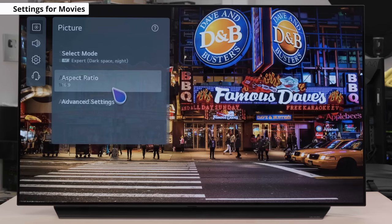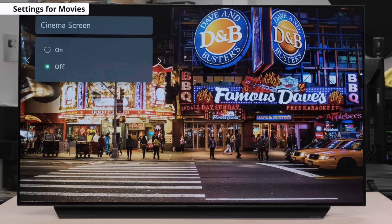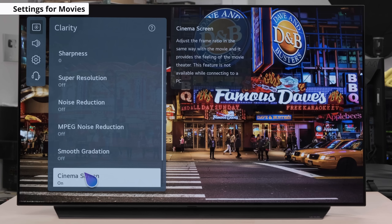Speaking about judder, there is an option on the C1's clarity tab within the advanced picture settings menu called Cinema Screen. This will help mitigate any kind of judder you may encounter, but do take note that while OLED Motion Pro is set to high, there will still be judder with content at 24p. What judder looks like is slight stutters that you may notice in scenes where the camera is panning. It's basically a mismatch between the refresh rate of the TV's panel and the frequency of the 24p video. We don't think judder will be much of an issue here on the LG C1, especially with this feature enabled.